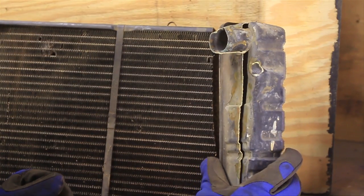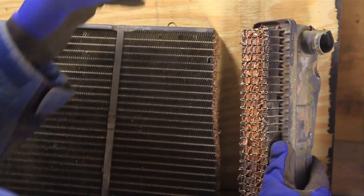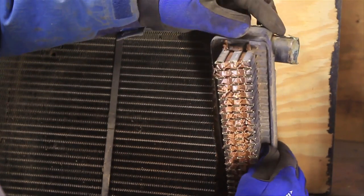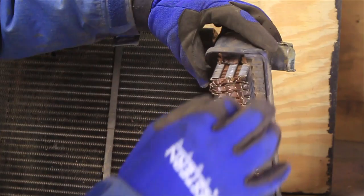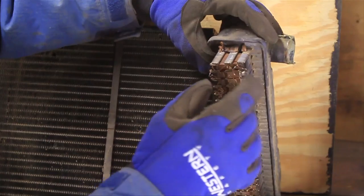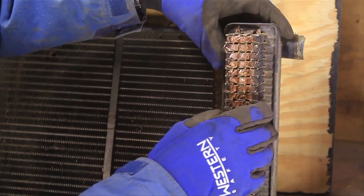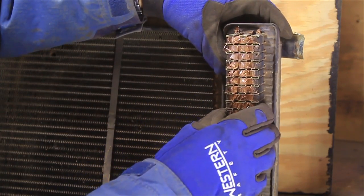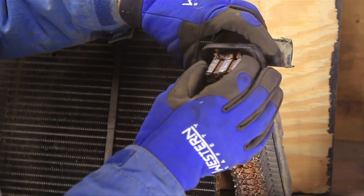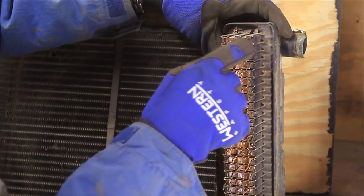This is an older radiator — it looks like it's made out of copper and brass. Right here I've cut a cross section and you can see this is a three-core radiator. A one-core radiator would just have one larger pipe running right through here, but this is a three-core and it has three separate pipes. Now, just because it's a three-core or a four-core doesn't mean it's got more cooling power, because those cores could be smaller. You could have 24 tiny little straws and not move a lot of fluid, so having a one-core or three-core doesn't really tell you much — what you need to know is how large the cores are.